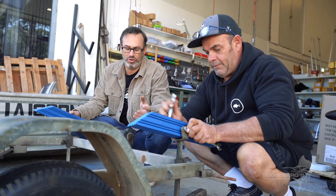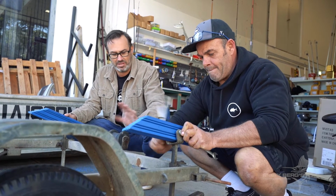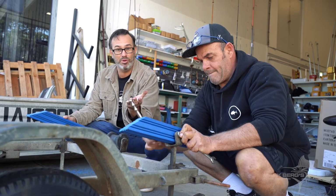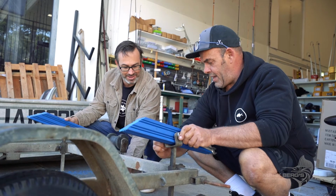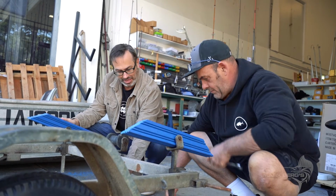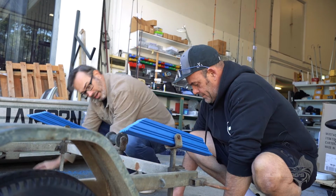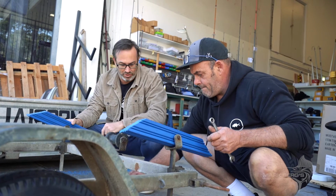Once you get it out on the water and you bring the boat back in, the first time you do it, you might think, okay, this has got to be adjusted, but they're a really easy adjustment. It's really just a bolt at the back, just to move them up and down. Very, very simple. So this one's just running loose at the moment. So we'll probably bring it up maybe an inch and tighten her up. That looks about right. It's a little bit lower than these two, but that V will hit that first anyway.